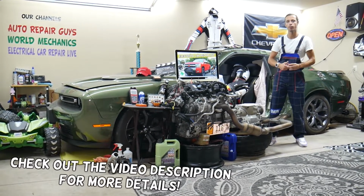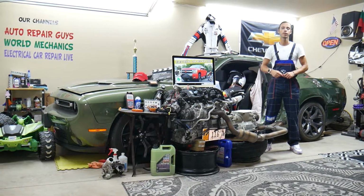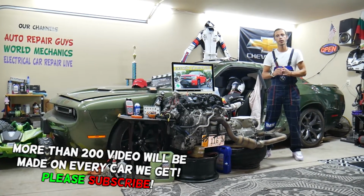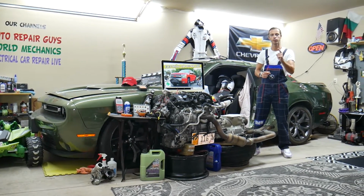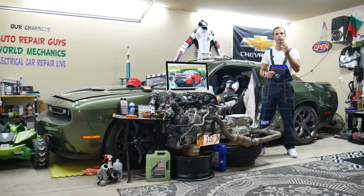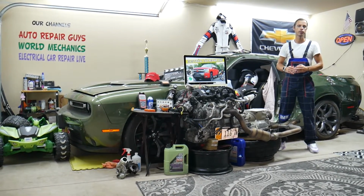Today will be a super helpful video to any of you having a Chevy Silverado, this generation from year 2007 to year 2013. If you need to find where your headlight fuses are located, you have 4 fuses. Why? Because you have one fuse for left low beam, one fuse for left high beam, one fuse for right low beam, one fuse for right high beam. So we will explain where you can find all these 4 fuses for the headlights.